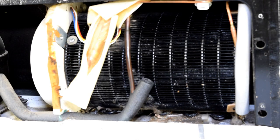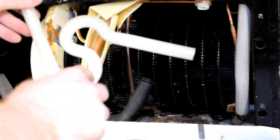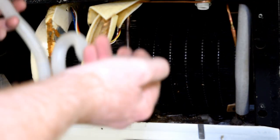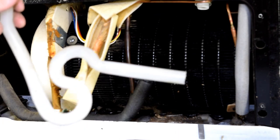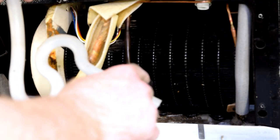Lastly, we're going to reinstall the defrost drain line. Knock as much of the dust off as I can. If yours is clogged, typically it's going to be right here. You can blow it out with compressed air or your lungs. You can run water down through here to try and flush it out, shake it around, blow through it again. It doesn't have to be perfect, but it does need a continuous flow where the water basically collects here, and as water fills in this tube it pushes out over the top.